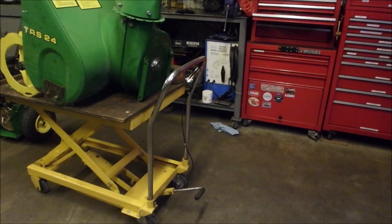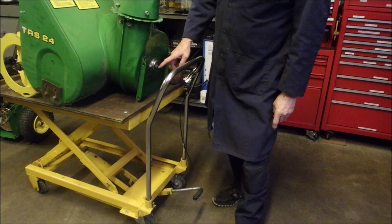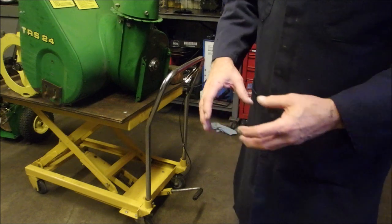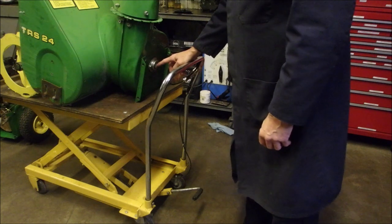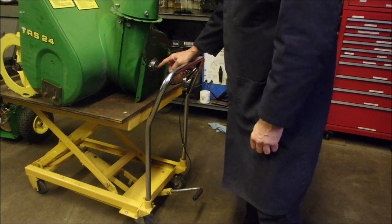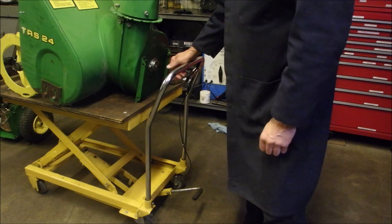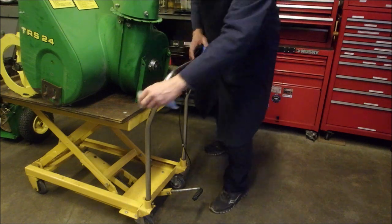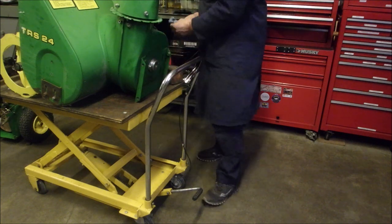All right, my friends, so the shaft coming through here, it's going to move, but it's going to move with the bearing. I know I'm speaking loud because of the furnace, but I always speak loud. If it was spinning in here, you'd want grease. But because it's locked in with a key, with the flywheel key, there's no movement here, so you don't want rust and stuff to build up on it to the point where you can't get it apart again. That's that. And that anti-seize gets over everything.